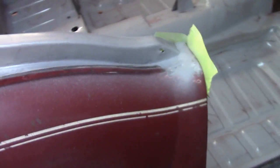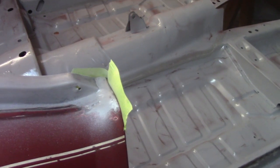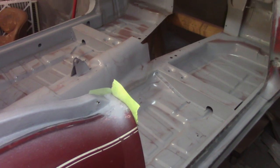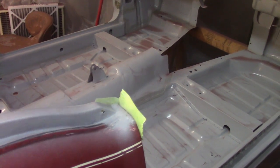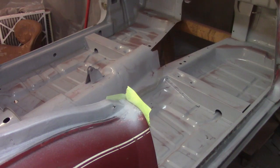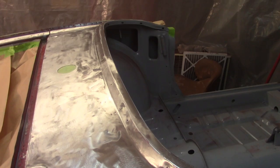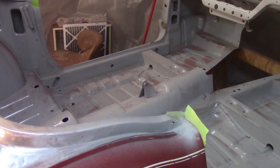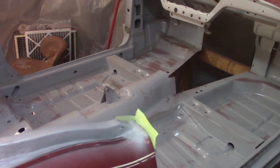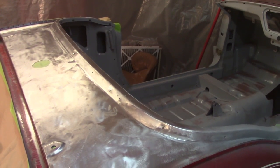All right, I obviously stopped painting there. If you can see here, you can really see it on the red, how it's all splotchy, little dots and everything. I've never had the paint lay down like that for me before, so what that told me essentially is that the paint was well on its way to curing up and activated, and I would be wasting my time and potentially getting a bad paint job if I laid down the epoxy primer. Since that is the base layer, the foundation of the entire paint job is going to rest on this, so I'm not going to take that chance and I'm not going to waste that time having to strip it all back out again. So I'll leave it like this until next visit, get it cleaned up, and try again.